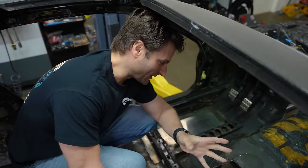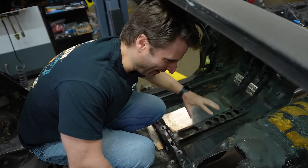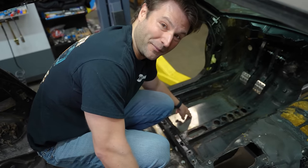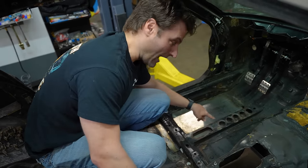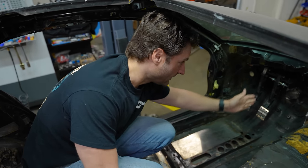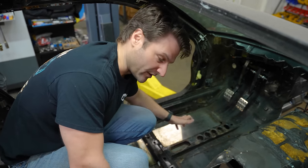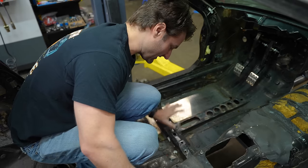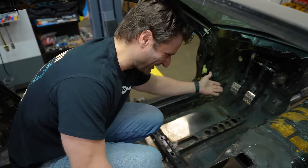I've made quite a few mistakes in my life and five of the worst ones are all in this area. That's the very first plate of steel I ever welded. Surprisingly, it held up much better than not having it in there. I did not realize how structural this stuff is — not just for your seat, but actually carrying the front frame rail. Thankfully, we have somebody who gave us one of their leftover RX-7 parts from Vegas, and we're going to cut out all of the rust and do it right. It's going to rigidize the chassis.